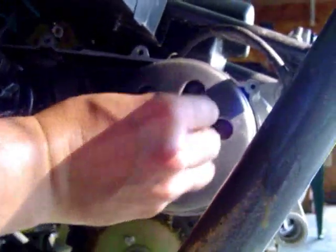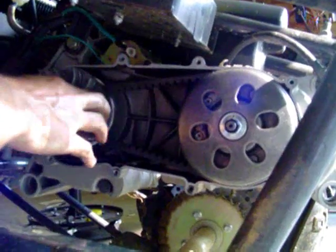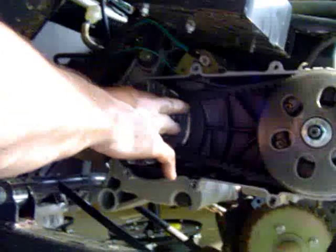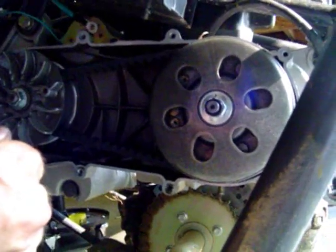We've got everything tightened up. Don't forget to put the rubber o-ring back where it belongs. Something else to note — we used 12-gram sliders in here; they change the weight depending on what type of performance you're looking for. We do a lot of flat tracking. If you're doing hilly terrain, you'll want to go with a lighter slider and possibly a larger main spring for the same purpose. We'll put everything back together and see you on one of the track attack videos. Thanks for watching.